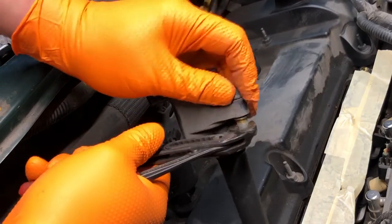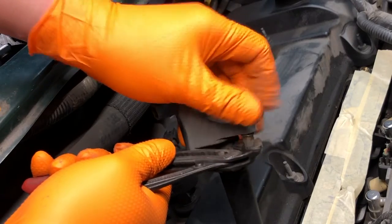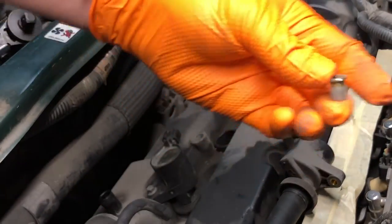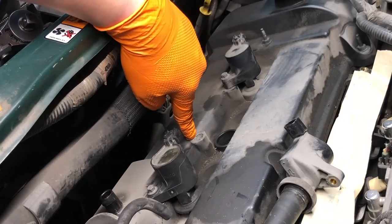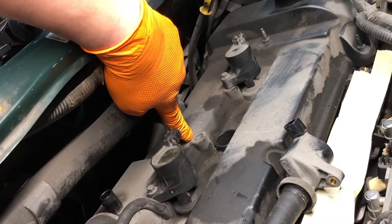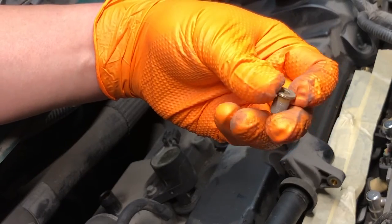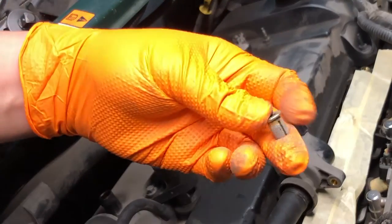It usually doesn't take much torque to break it free from the insert. There you go — the bolt is coming free. They're rather long bolts, and as you can see, the insert is not damaged from doing this. From here, I'll normally spray brake cleaner or something in the hole to get it clean, blow some compressed air in it, and then apply some glue to the outside of the nutsert and jam it back in the hole to cure.